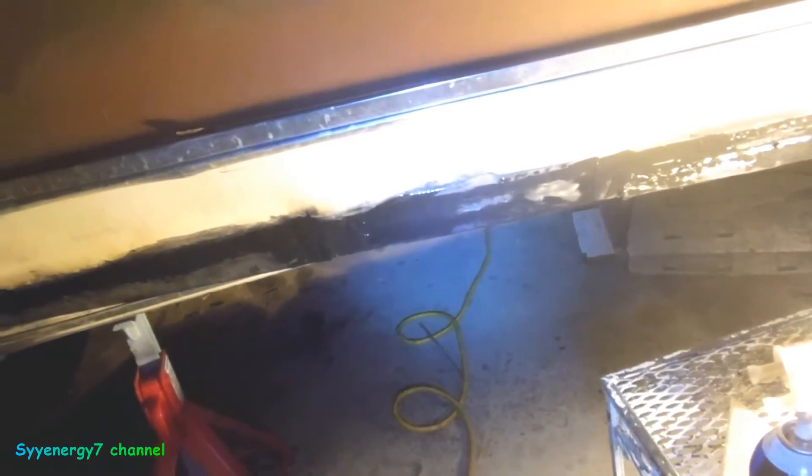The one mistake I made with the bottom of this door was — body people that do automotive work usually use 18 gauge or even 20 gauge to fix panels. Most people wouldn't even try to fix the bottom of this door because it wasn't just a door skin that was rotted out — it was the door itself. Just to save money I figured I'd make some panels, so I did 16 gauge, and that was a bitch to work with. I ended up putting 18 gauge to finish it off, and put some 18 gauge over the 16 gauge because I couldn't bend the 16 gauge good enough.